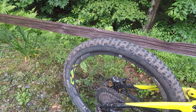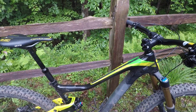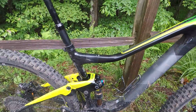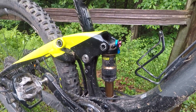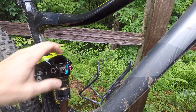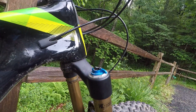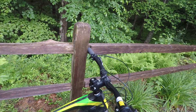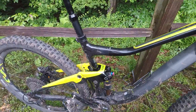This bike is a very enjoyable bike to ride on longer rides. The guys I've been riding with are all on cross-country bikes — one of them is on a Camber, which is a mix between trail and cross-country, but definitely less travel. I've had no problems keeping up with these guys. All the others are on Specialized bikes with a brain shock, and anytime they wanted to fully lock out the rear end they had to get off the bike and turn some knobs. What's nice about this bike is if you want to lock it up, you just reach down and move the lever. I'll leave the suspension on the fork, and when it's time to head downhill I pop those open, drop the saddle especially for a technical descent, and I'm ready — it takes about two seconds to go from a really solid, steady climber to an awesome descender.